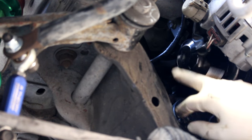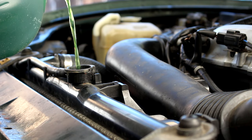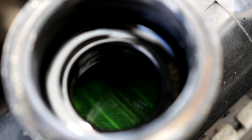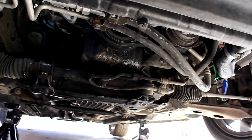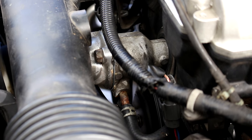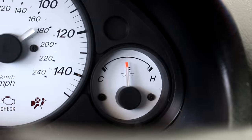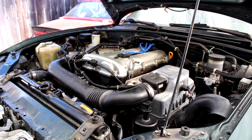Now I can start buttoning things up. Get that oil filter in place, get some oil in the engine, fill the cooling system all the way to the top. Make sure your overflow tank is at the right level, then go ahead and start the car up and let it warm up with the nose up in the air — that helps any air bubbles in the cooling system make it to the top. It'll probably drink some coolant when you fire it up, so keep an eye on that level and add as necessary. While the car is warming up, take a look underneath and check for any leaks at every hose connection, every gasket — basically everything you touched. After it comes all the way up to temperature, seal up that radiator, check your oil dipstick, and you should be ready to take it for a drive.